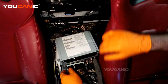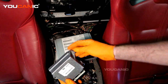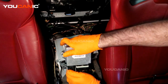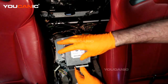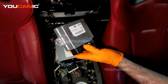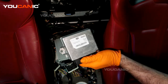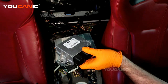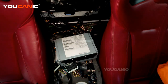Once you get the three bolts undone you'll be able to pull it out and forward. Then press the black tab and pull — not twist — to unlock the connector. Press the tab and pull to unlock it. That is the removal of your airbag module, or SRS module. You can ship it to have it repaired, then put it back on your vehicle to have the codes removed from the dash panel and your airbag system will work properly.